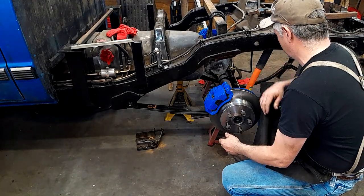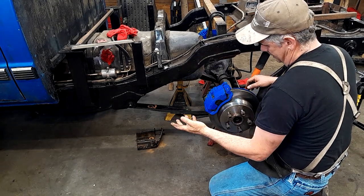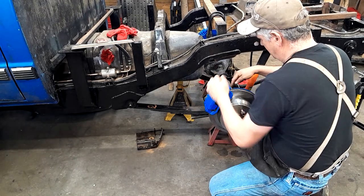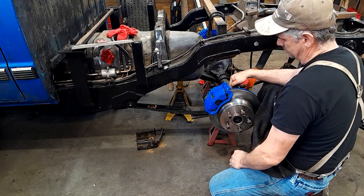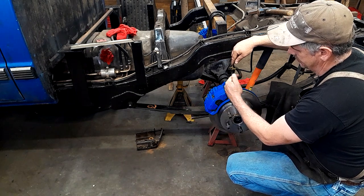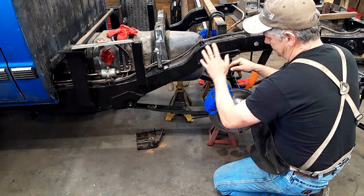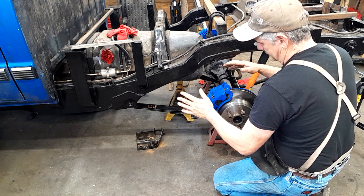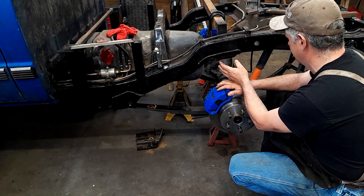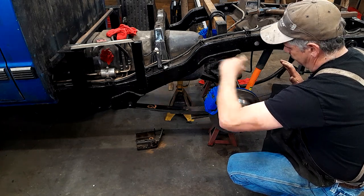Spring is in the air, so we're going to work on springs. This is a 2000 Blazer frame on a 93 two-wheel drive pickup truck. The locating pin for the spring, where your axle locates on the spring pocket back here, is 1 inch further back from the eyelet on a pickup truck versus a Blazer, as far as I can compute that. That makes my drive shaft an inch too long, which is no big deal really. But the important part was my tires were an inch too far forward to fit the wheel arch.